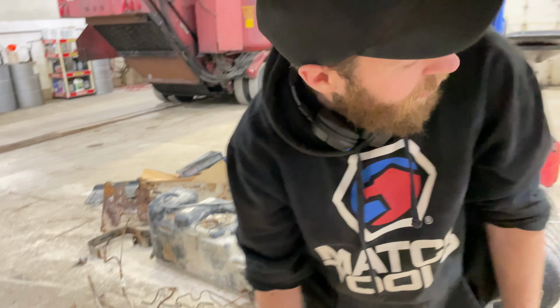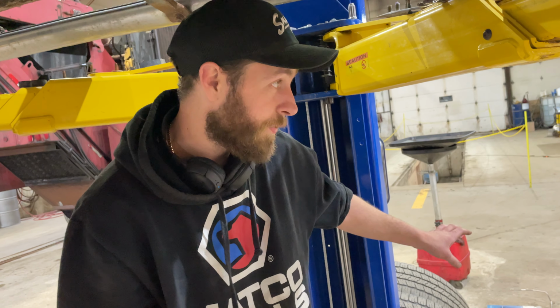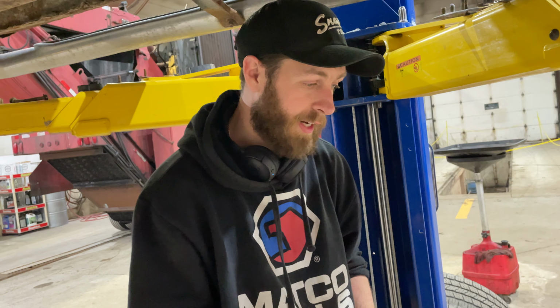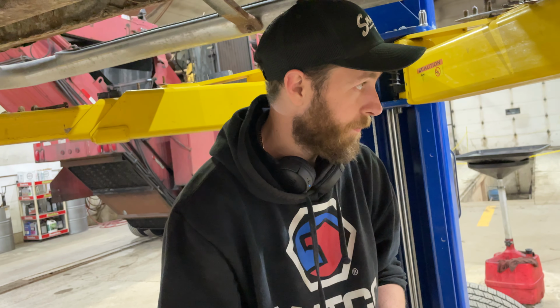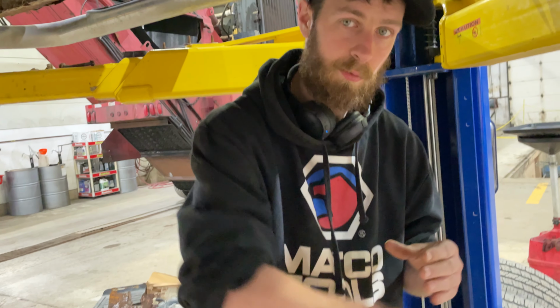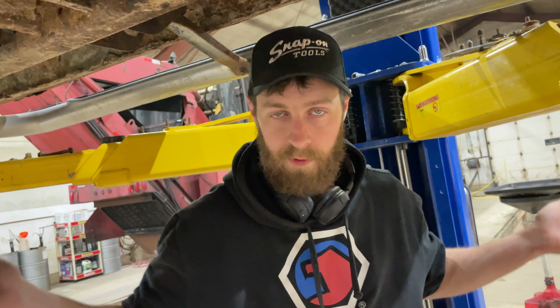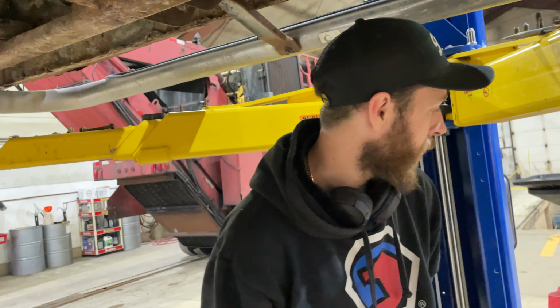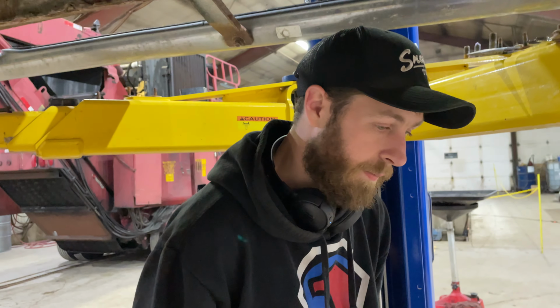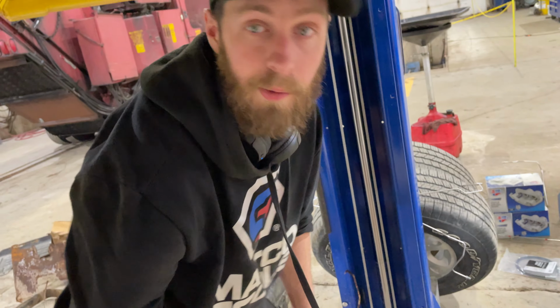So I'm like, well, I'm just gonna cut the lines. Now in this case, I wasn't actually able to flare those lines and join them back together, which was my plan. They are stainless lines, and the metal's so hard that just trying to use the flare tool, it was just wiping the teeth right off of the clamp. So there may be another tool that is available that will flare stainless. I'm sure there must be, but I wasn't able to do it. So sort of unfortunate, but probably end up just getting a roll of nickel copper brake line and make my own lines for that one.